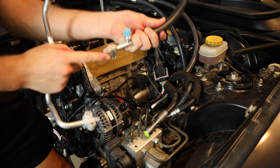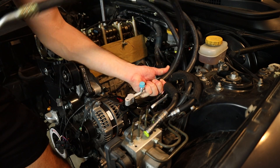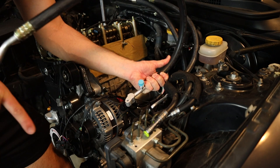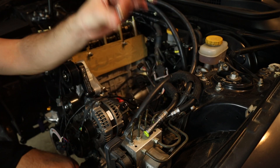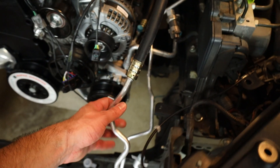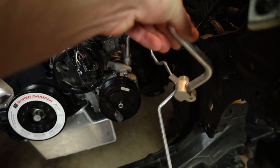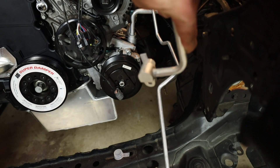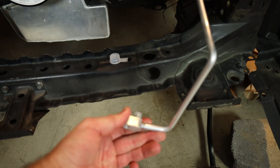What you're trying to do is get this mounted to the back side of the AC compressor, and then this is going to loop around so that this end can come around to the condenser up by the radiator. We're just going to take this 10mm flange nut, thread it on top, and tighten it down. So here's that other line we just installed — you can see it goes around, loops, and comes towards the front. This will connect to the top of your condenser, and the big long line will connect to the bottom one.